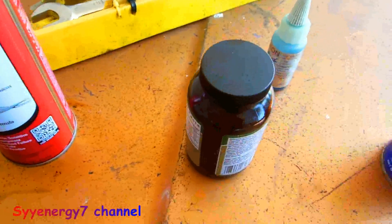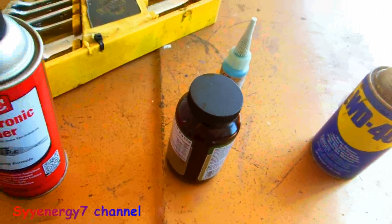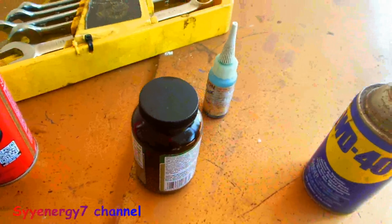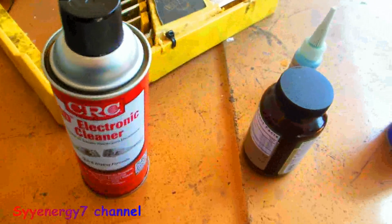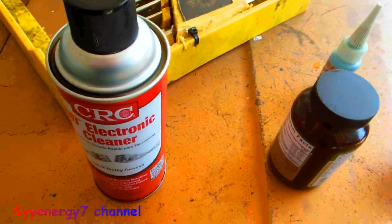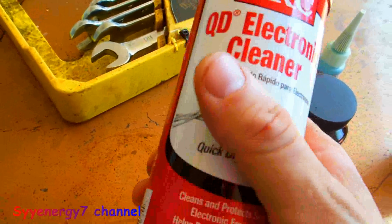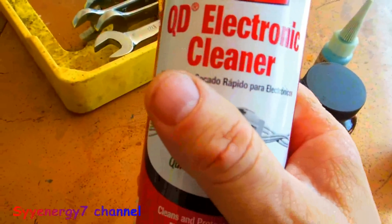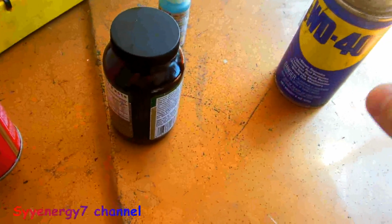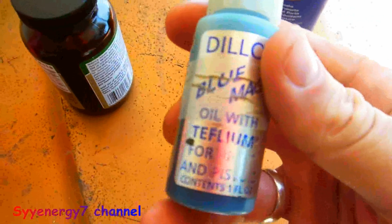Now what I did before was I actually took a couple of the tumblers out, but one of them sticks now just a tiny little bit. Sometimes I might have to smack the column, then it turns. It does it once in a blue moon, but I'm figuring I'm just going to clean it up really good. If it doesn't work, I'll take another one of the tumblers out, but this is the right way to clean the lock. If you're having a problem with the thing sticking, you can take the tumblers out, but you don't want to do that. Use the right cleaner. Don't use this stuff. You want to get it where there's no oil on it, and use something like graphite. And I'm going to try this.